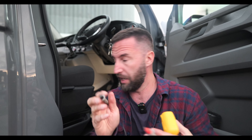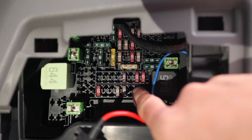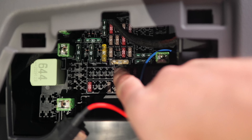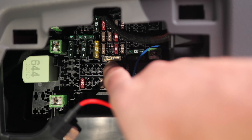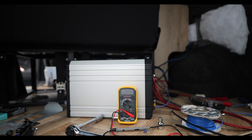If you're wondering how to find your ignition live on another vehicle: touch the body of the vehicle where there's good continuity and then touch the back of the fuses one by one with your multimeter, turning your engine on and off. You'll work out which is the live fuse — if it's on when the engine's on, you know it's the one. If it's always on, don't use it because it will flatten your battery. You only want it on when your ignition is on. There's a little yellow 25 amp fuse — go from the bottom row up to the next row, and that's where I've gone.